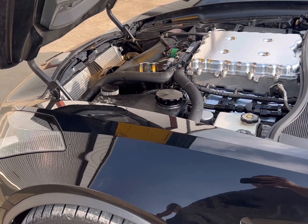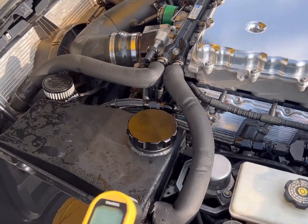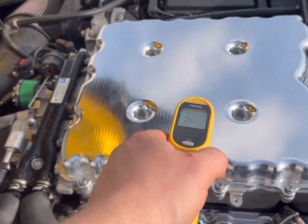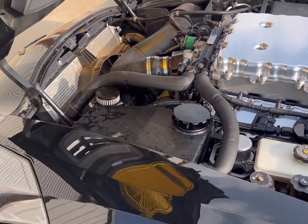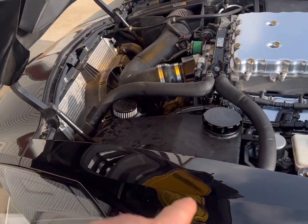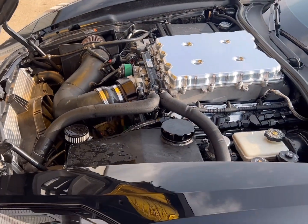The key to keeping cold is to run a nice size tank like this. If we have a look here at the blower, you have a 50 degree temperature there on the blower. The key to keeping cold is to run fluid volume. The chiller's job is to make this tank cold and then that fluid volume is going to keep you cold while you're under wide open throttle.